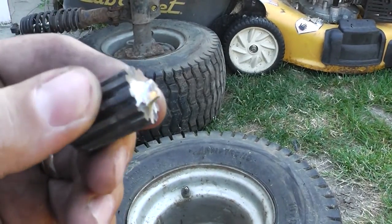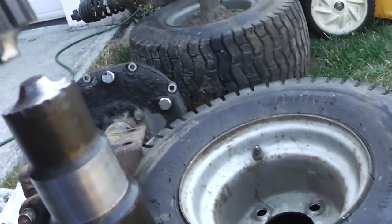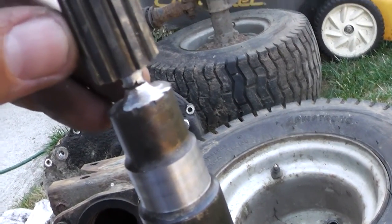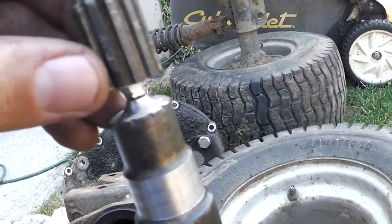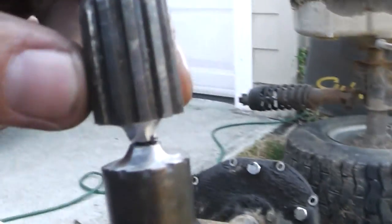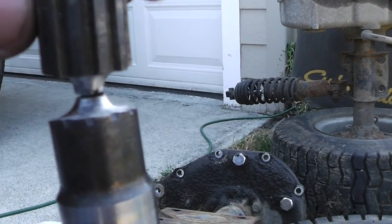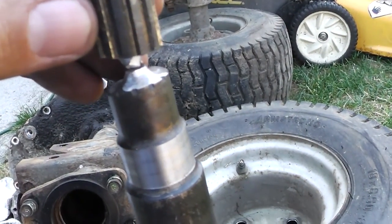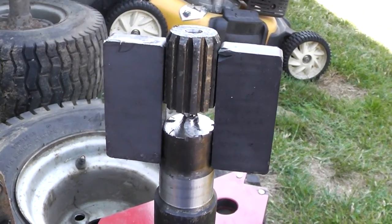I ground off all the broken material off both pieces, kept the centers, but that's a lot of fill to put back. I don't know — as long as I get it true it shouldn't matter. That's at least half an inch of fill needed. I've got some magnets I'm going to put on here to help true it up — let me go grab them.